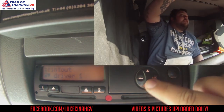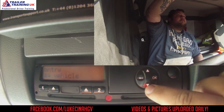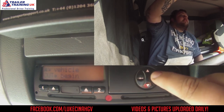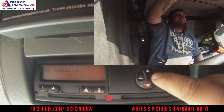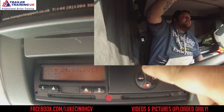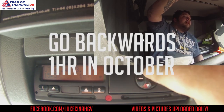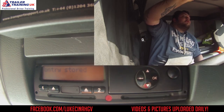Press the OK button, press down five times. It says 'Entry Vehicle' — press the OK button, go down twice to 'Local Time', press OK, and then you want to change the time. So at the moment it's 15:57. The clocks are going to go forward an hour, so we want it to be 16:57. Press OK. Entry is stored.